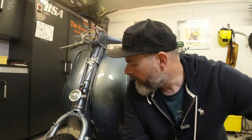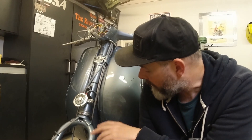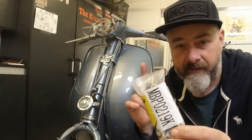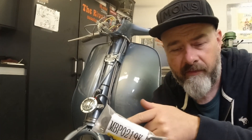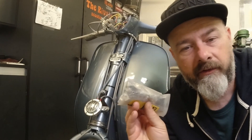This is probably the most daunting part of a Lambretta restoration, especially if you've got nice shiny paint like we've got here. What I was waiting for was a fixing kit for the floorboards — all the floorboard strips — so I can fit the horncast, the mudguard, footboard rubbers, and secure everything down, and hopefully fire it up. The reason it's been loose is I didn't want it rattling around. So I bought the MB floorboard kit — it contains everything you need and they're all shiny stainless steel.